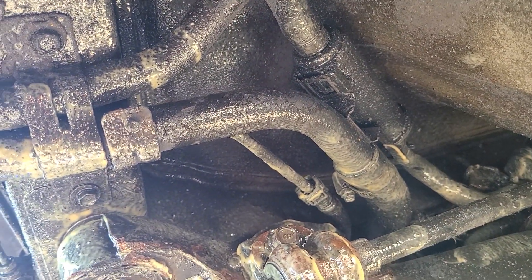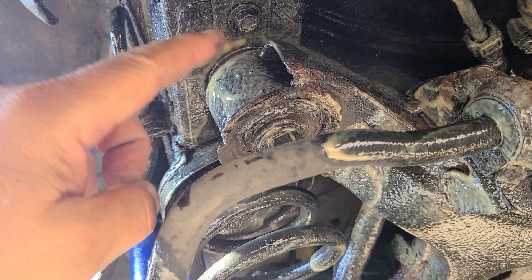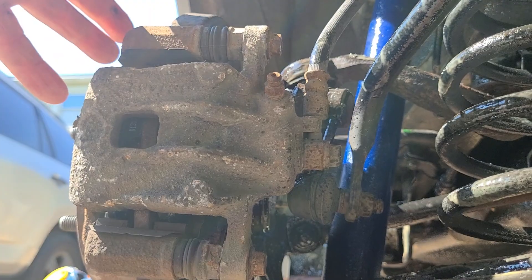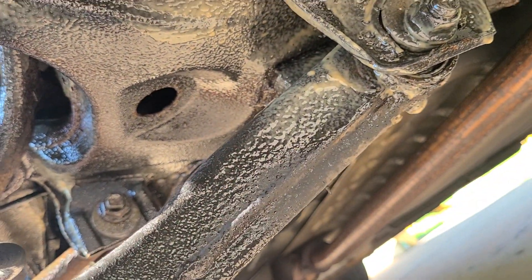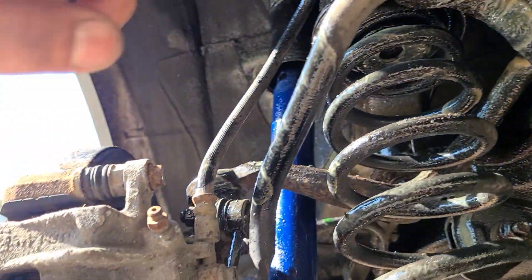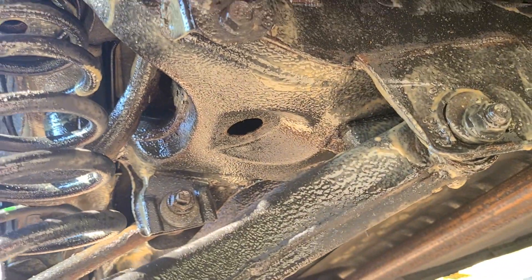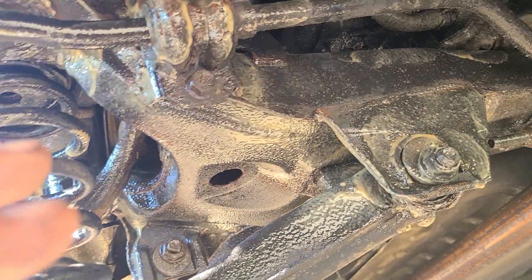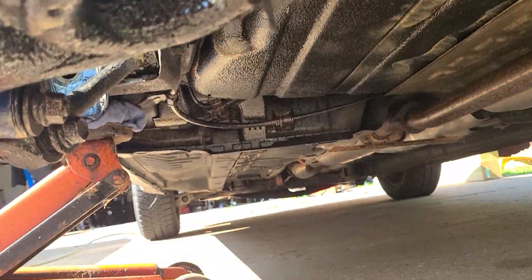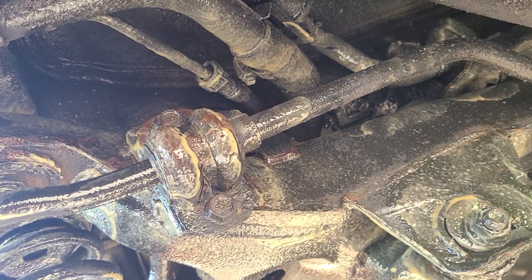All of your filler neck hoses and anything from your evap canister — as you can see, the subframe bolts into the body. You want to get into the body cavities and make sure you protect all that, all of these lower control arms. You don't want to spray the rotors down, obviously, but if a little bit is sprayed on there, it's not the end of the day — it'll burn off. All this here will turn into like a wax. It protects it from moisture, it protects it from the salt. Anywhere where the water hits here in the wheel wells, this is where you're going to want to touch it up each fall. Once you've done all the panels, you touch them up but it's not as extensive each year. I've already done this car once before, so we're mainly just touching everything up and going back through. This is a tutorial to show you what you really want to do. If you plan on keeping your vehicles for any length of time in the rust belt, you want to protect them.